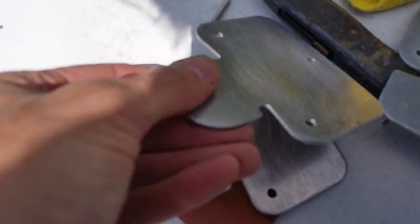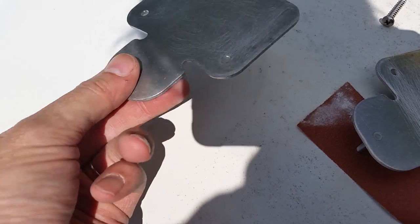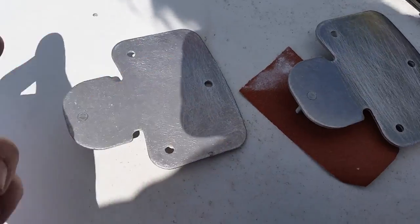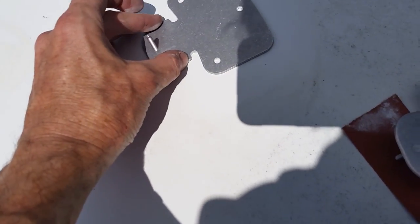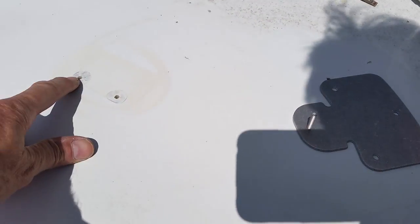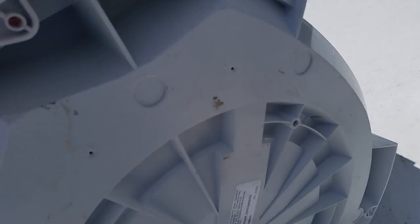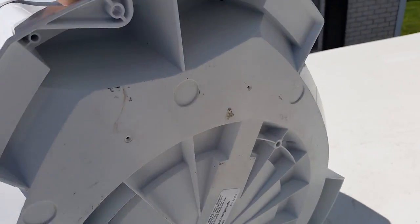I've got some sandpaper and I'm getting all my plates here. The instructions say don't get any sealant on this area - only in this place - and I've got my holes pre-drilled. I took sandpaper and scuffed it up slightly. I'm about to put this sealant on here, put the feet in place, and then it won't be going anywhere for a long time. I'll put a little sealant in these holes where the old bracket was where the old dish used to land. They also warn about keeping these drain holes clear - you've got four or five drain holes in the bottom of this thing, because those things will probably condensate and sweat sometimes, and you want that moisture to get out.